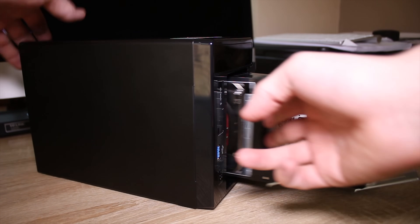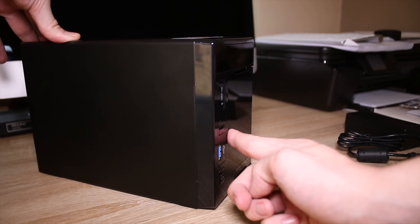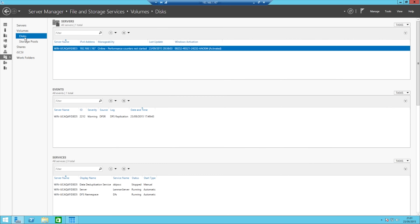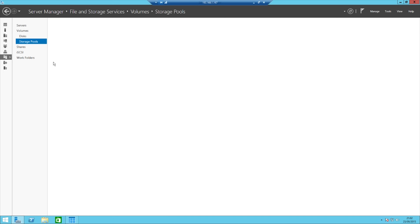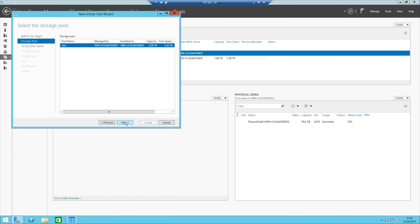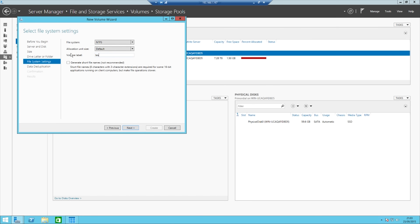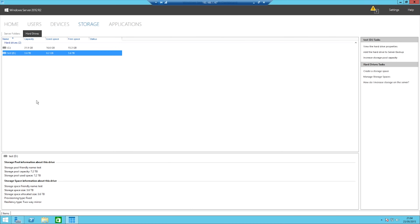Because the user manual covers how to initially set up the device, what I'm going to cover is how to set up a storage pool — which is what Microsoft calls a RAID array — with these two drives in a mirrored fashion, so RAID 1. You'll need to have the dashboard and server manager open. First, go to the server manager, click on files and storage services, then go to volumes and disks and check the status of your disks. Make sure they're both detected, then you'll probably need to reset the disks — basically formatting them and leaving them as an unknown partition type. Once you've done that, go into the storage pools option and right-click in the top box — there's no file menu for some reason — and hit new storage pool.